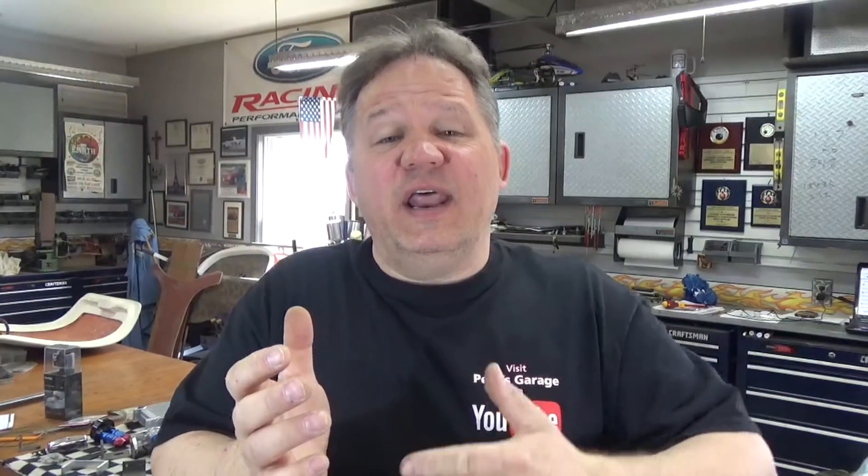I'm wondering where did all this rust come from with gasoline in it all winter long. Well, it gets really cold in Buffalo — zero degrees — and I started thinking about the gasoline. I used 10% ethanol gasoline. What does ethanol do? Ethanol absorbs water. The water and gasoline sits all winter long and then it freezes, it thaws, it freezes, it thaws, and it rusts the tank on the inside. Not only that, I took the carburetor out, pulled the bowl off, and I was pulling out this white gooey substance — and I knew for sure it was an ethanol problem.